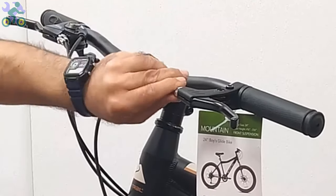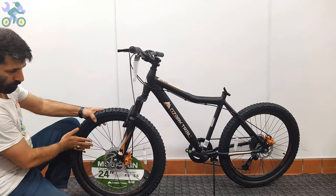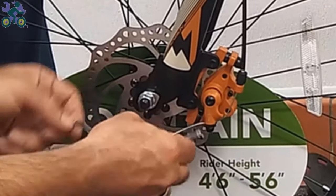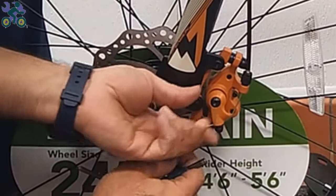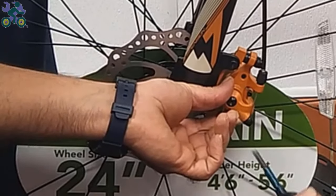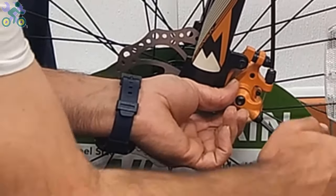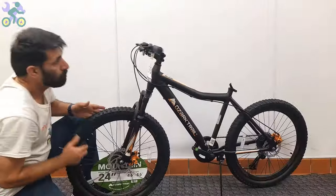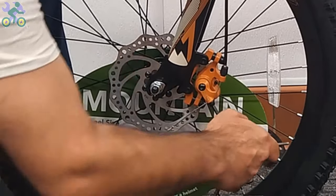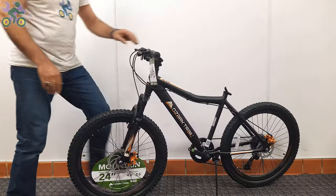Close the adjustable barrel on the brake handle to the end and make sure that the groove of the adjustable barrel is not aligned with the groove of the brake handle so that the brake wire doesn't come out. Loosen the anchor nut off the cable and push the brake arm upward and hold it. Pull the wire to remove any slack and then tighten the cable anchor nut. At the end, put the remaining part of the brake wire to the outside of the rim so that it doesn't make noise when it hits the wheel during movement.